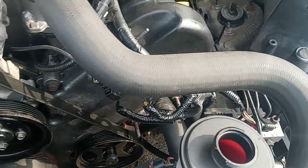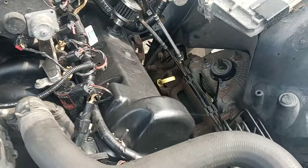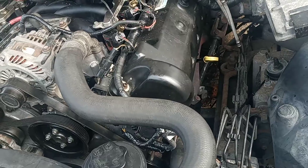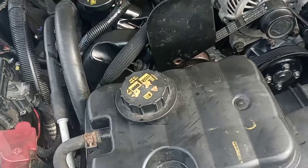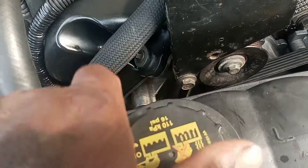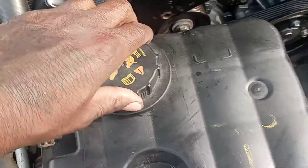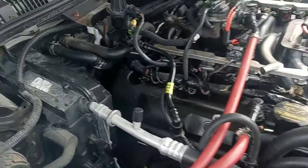She has fluids: power steering oil, about six to six and a half quarts of oil, and coolant — I only put one gallon in there for now so I can burp the system. It's a little dirty down here; it's just hard to clean these things out, there are stains.